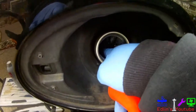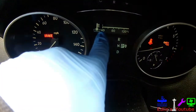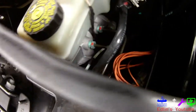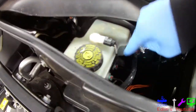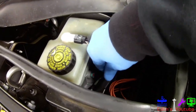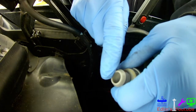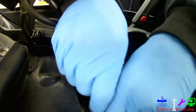A little funnel pushes it down past the cover in there. The part that needs your car warmed up is the brake booster — this will clean out your back end, especially your catalytic converters. This is where you see all the white smoke you see in other YouTube videos where people use Seafoam. Your brake booster is right here on the driver's side, right in front of you — you can see the little brake canister, and right there is the brake booster.